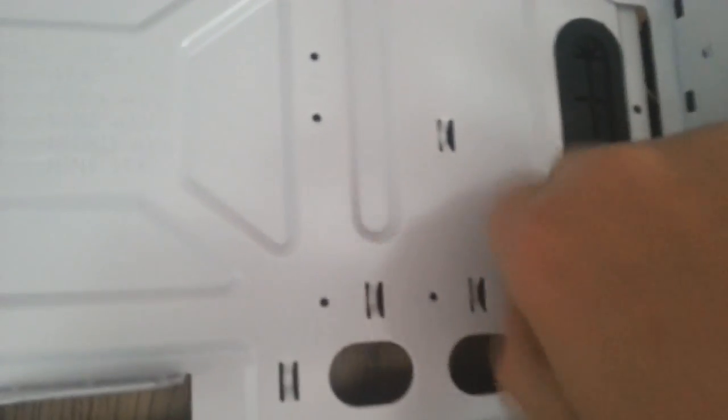Now on this particular board I have an ATX motherboard. They've been nice — they've listed out the holes for you. So you've just got to find all the A's. So there's an A. Screw it in by hand first.